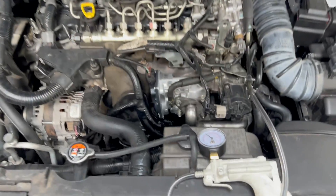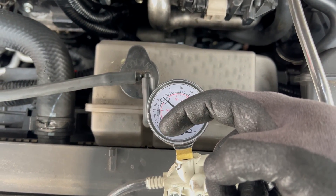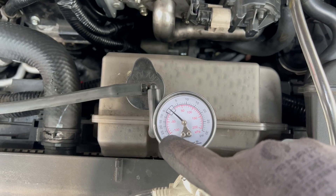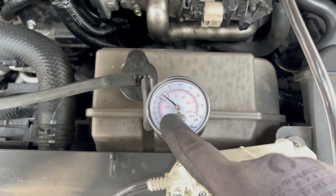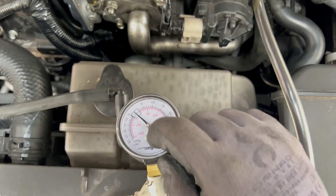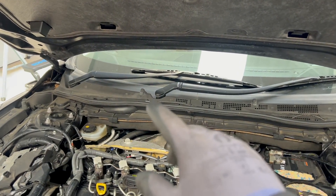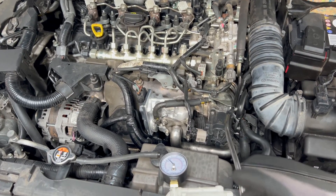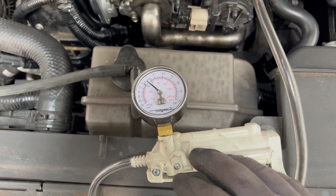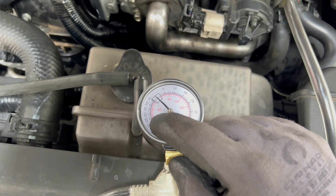When we start up the car, we want to see the vacuum applied quite fast — about 25 inches of mercury is fine, or more. In kPa terms, we're looking at around 90 kPa because it reads negative 100 kPa on the gauge. The brand new vacuum pump on the spec sheet is supposed to be 7.6, so if you deduct 7.6 from 100, that gives you 92.4 — basically 92 kPa is the target zero point.